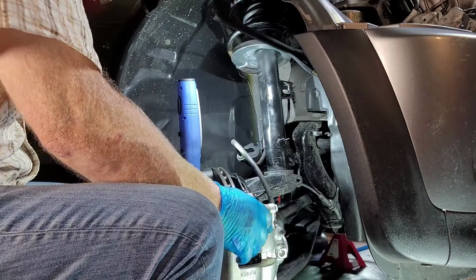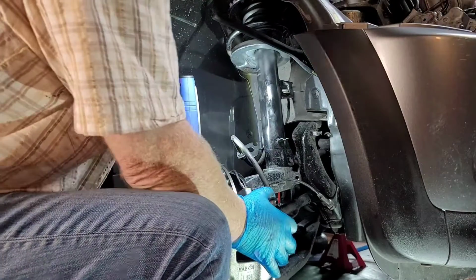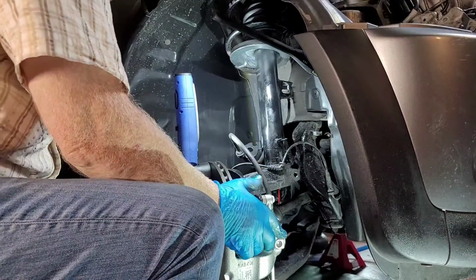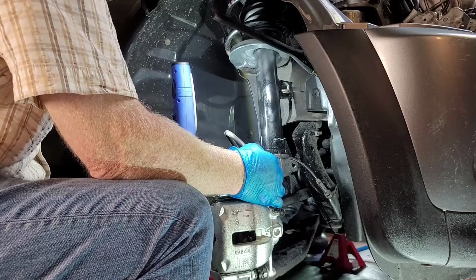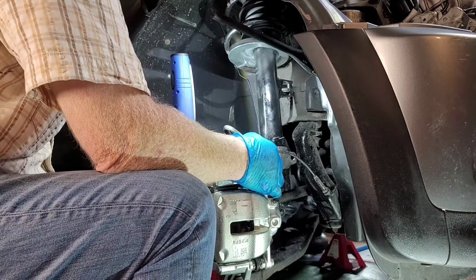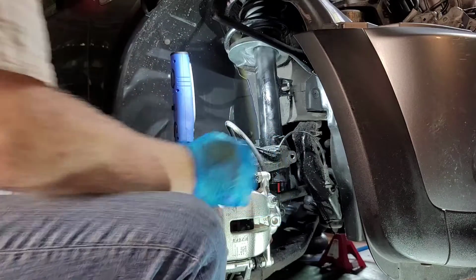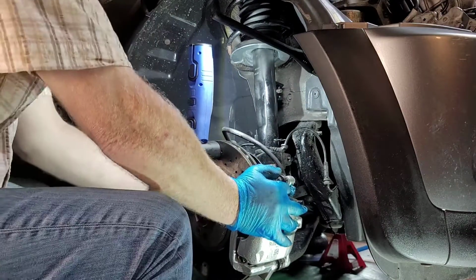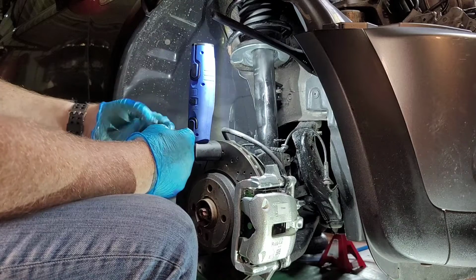Line it up as best you can and just start bringing up your jack. She should slide in fairly nicely. Ah, that's fallen into place, lovely, look. Almost there. There it is. Now the whole strut is moving, so that sounds good. Straighten it up here like this. And I'll put the bolt in next.